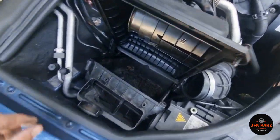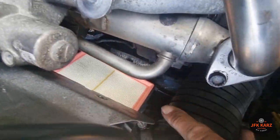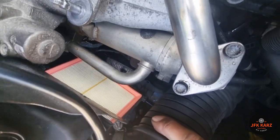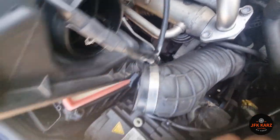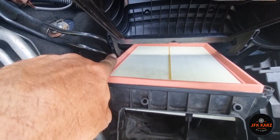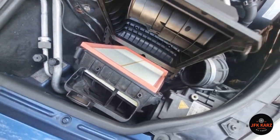I'm going to get a little brush and give that a clean before I put the new filter in. Old filter's there. In front of the silver plate there's actually a hole, and then there's one to the left of that — really difficult to see — so that's where it's going to push-fit back into. You can see little arms on the cover each side, so just make sure they tuck underneath and that'll create the seal. Then do the screws back up — jiggle it around and get it in position.